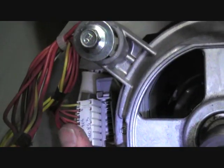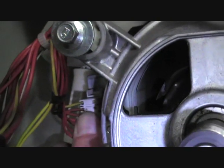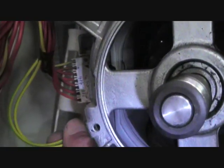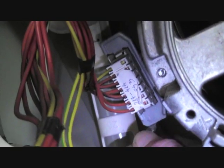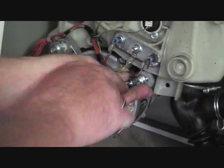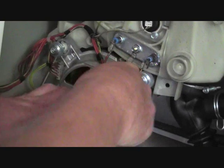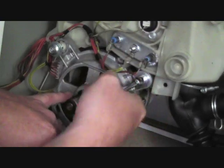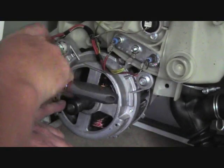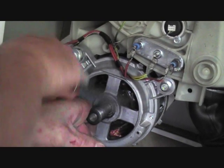Right, now we'll connect the wiring up. This is a push fit block connector. Usually can only go in one way. This motor also has an earth wire, female spade going onto a male. Now we'll actually do up the motor. I normally do these bolts hand tight, followed by 1/4 of a turn of pressure, which will usually be adequate. And now all we need to do is replace the belt.